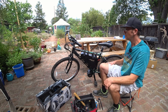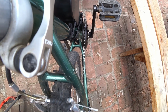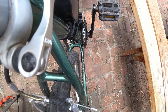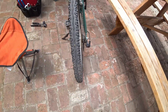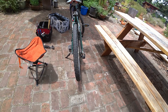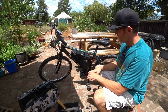Fit issue number one: if you can see down there, the side of the mid-drive motor is actually up against the chain stay. I could shim it out and alleviate some of that, but part of the problem is that it's up against the frame and I didn't really realize it right away. The problem then is that if I shim it out, you can see my chain line is going to be pushed out even further, so I'd only really have a decent chain line in the highest few gears. I'm just going to scrap it on this bike and find a better-suited one.